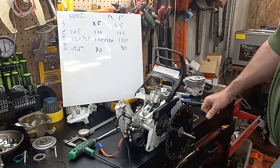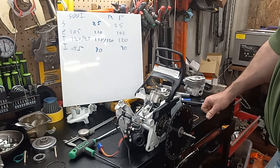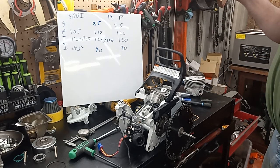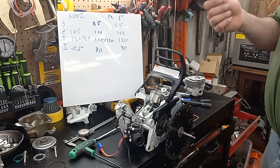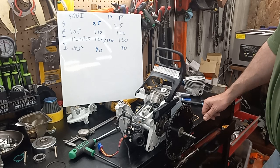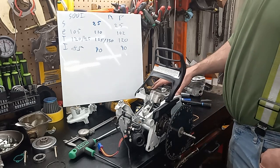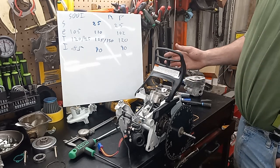If you're building saws and all you're doing is a base gasket delete only — some saws at around 110 you can bring to 105 and then do a base gasket delete if there's room, and that's okay. But if you're already at 105 and you drop the base gasket, only raise it the thickness of your gasket, because if you're not doing machine work that's a safe zone. It'll keep you from building a lackluster saw.